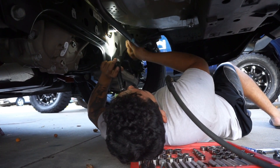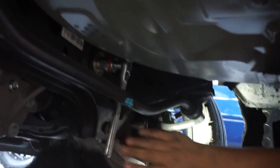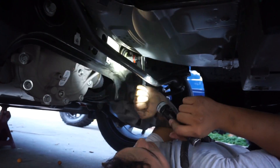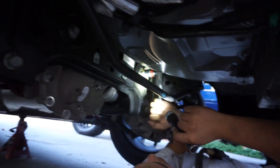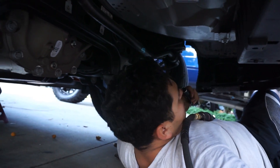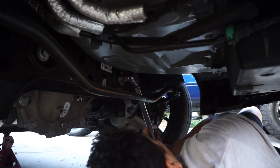What happened here is we actually didn't loosen the rear subframe bolts enough to get my tool in, so for most of the time I've been using a crescent wrench just to get it close enough to get my ratchet in. Right now you just want to line up the tabs inside — I showed you guys earlier, there are tabs in there that you need to line up properly. Then we're going to torque that down to spec, which was 129 foot-pounds. After 100 miles you've got to re-torque it. I lowered that side a little more and now I have plenty of clearance to torque it down to spec.